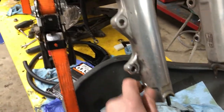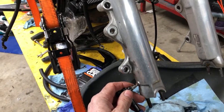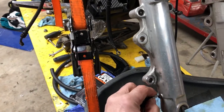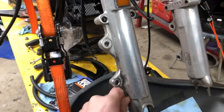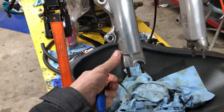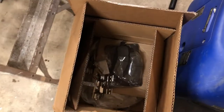That's a little better - it's got a nice seal on it too. I really like these rubber seals. I'm too busy right now, too much on the go, so I'm just going to get these draining and leave it sit for a couple days. The oil capacity - some people put 15 weight in, some put 20 weight. The capacity is 5 ounces if it's a quick oil change, 6 ounces if you let it sit for a week or so and let it drain out.